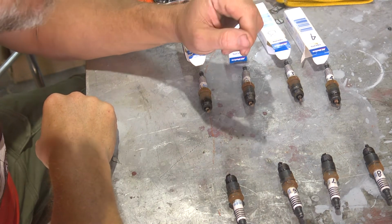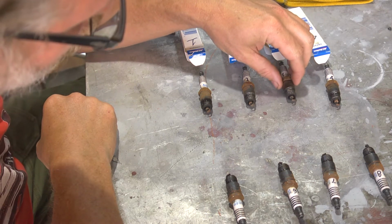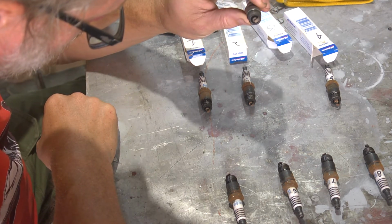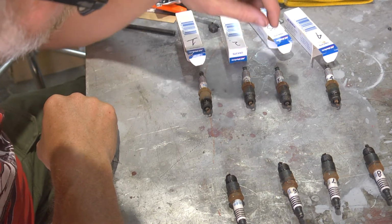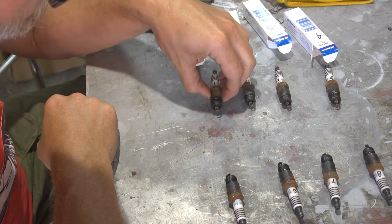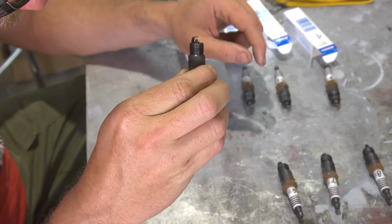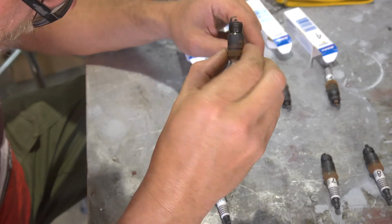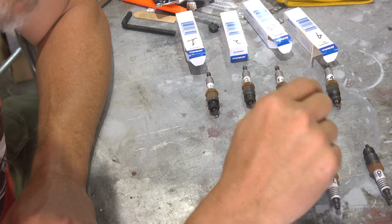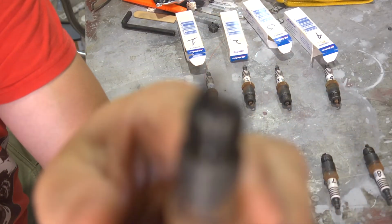Okay, at first glance, all of these look very, very similar. There's not any of them jumping out as being overly rich or overly lean, or more rich than lean relative to the ones around them. Number 3 looks a little bit rich versus 4 and 2. As does 1, but it's so close. And number 5 is a little on the rich side versus 6 and 7. So, an argument exists that with that variation, and I'm going to say that's a pretty minor variation. Here, let me show you what I'm talking about.